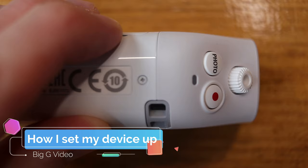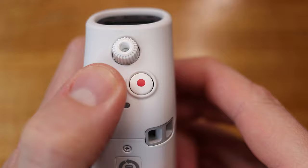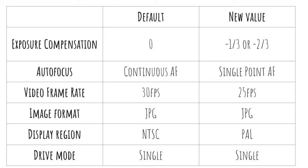How I set my device up: first I set the diopter to match my vision. There are only five buttons, so navigating the menus is tricky, but it wasn't too bad using the photo or video button to move up and down and the zoom button as a select button. As a default the device is in continuous autofocus and films at 30 frames per second. Images are taken in JPEG with no way to change that. I changed to single point autofocus as I found it quicker — it means I have to half-press the photo button with the central AF point, but there's no hunting.